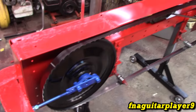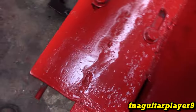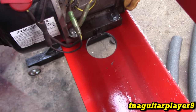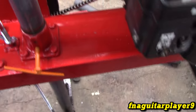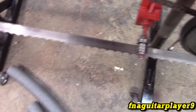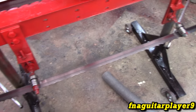It's all back together. I lock-nutted all the set screws and put a double set of screws in one of the cams. Also put about 5 shots of grease into each bearing just to make sure. Drilled the extra oil drain hole. Chain tension is just about right - the only bad thing is it's non-adjustable, but that's how a lot of mini bikes are too. Chain oil should keep it pretty tight, and this is a heavy-duty pre-stretch type so it shouldn't stretch too much. Readjusted the bearings - got a little more tension, feels right where it should be now. So now we just have to build the track system - going to do all of that off camera.